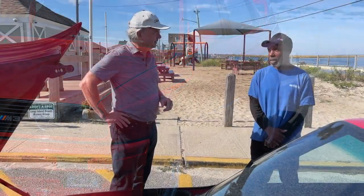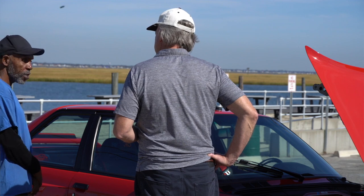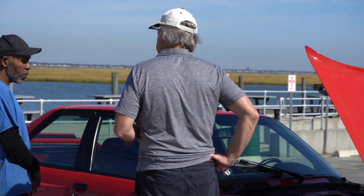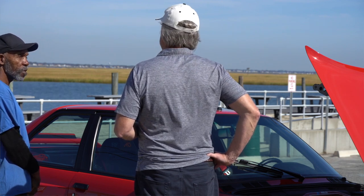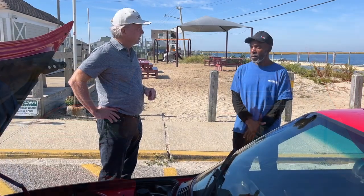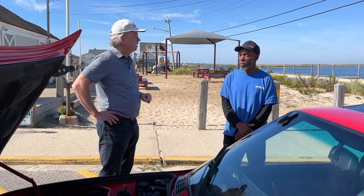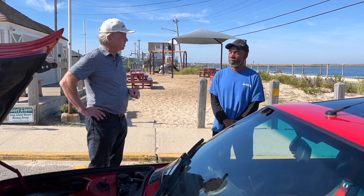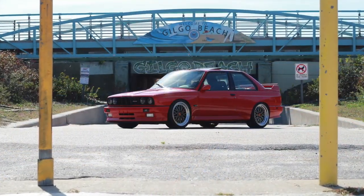Yeah, well, basically, my son and I, we have a business, Autocraft. We specialize in BMWs, all generations, new, old. We actually have the record right now for the new M3, the G80 M3. We have the record for the most horsepower from a stock motor. No kidding. So what would that be? 865 to the wheel. Wow. That's increased fuel, upgraded turbos, but the motor itself is stock. Yeah, because out of the factory, what is the G80 horsepower? They claim a little over 500. Wow, so you added over 300 horsepower to the G80? How's it drive? Just like stock. Really? You can't even tell.